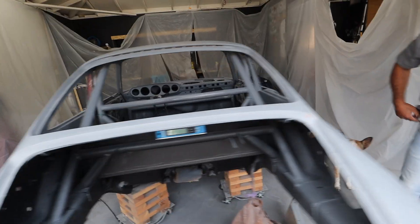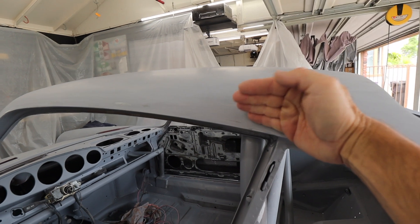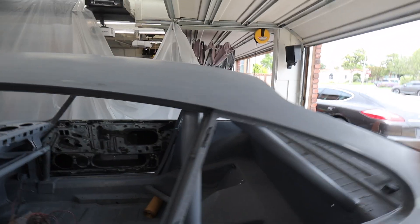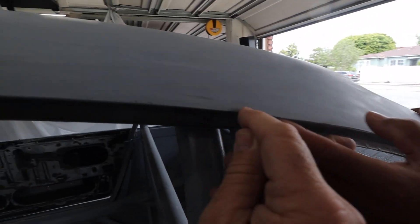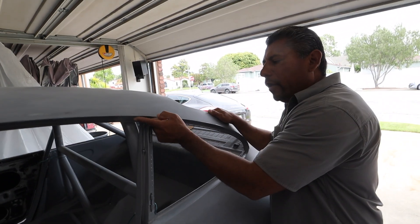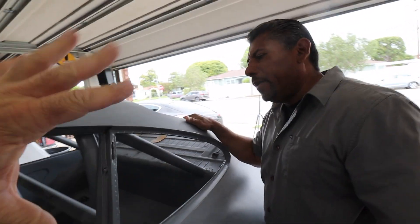I've done a drip rail delete, which was super complicated. There are three different layers — a curve that goes up, one straight, one the other way — three different things. When you cut out the middle it wants to split, and there's seam sealer and lead that you don't want to try to file into. I've got a spot on the corner here that really needs some work. You'd want to put a little tack weld in, build up the metal, then grind it. The problem is there's so much lead that it turns into a hole — the answer would be Dura Glass, the fiberglass-reinforced filler.